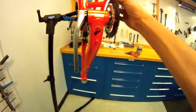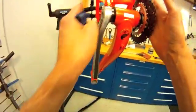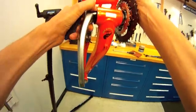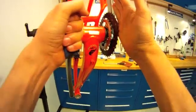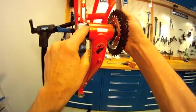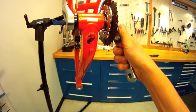This drag we get here is just normal seal drag from the system — simply the way these bearings are. We do need now to take up the side-to-side motion of the crank; we don't want it moving left to right when we ride. That's what this adjustment nut is for. We run it toward the bearing gently until we just strike it and then stop — not pushing tight into the bearings, just stop at the bearings. Then there's a small set screw, a 1.5mm hex wrench, that locks that nut in place. The cranks are ready for pedal installation.